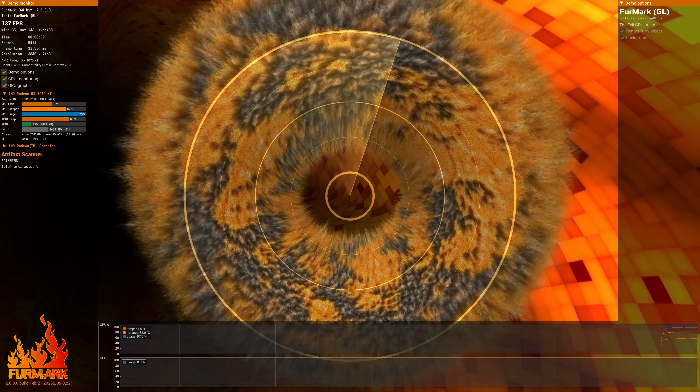That said, there is no guarantee that an overclock that was stable won't become unstable over time. But if that ever happens, you can simply go back to your default settings and follow this process again. Something I typically do once I discover my stable overclock is to purposely back off a little to ensure that I stay away from the stability edge. That will give you some room for thermal paste deterioration and help you avoid having to go through this process again in the future.